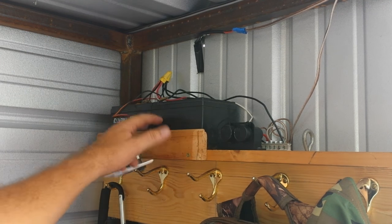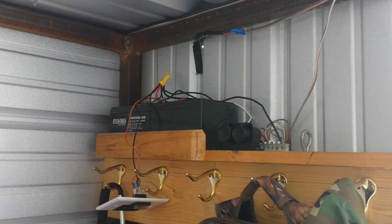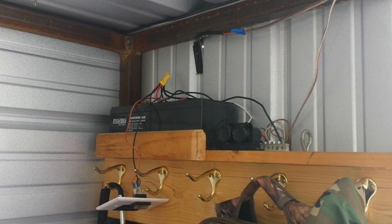So I got them hooked back up. Don't have them charged yet. We're gonna eventually run one of those little 1.5 or 2 amp solar chargers out the back just to keep them topped off while it's sitting here parked. Anyway, that's 12 amp hours. I got them in parallel, so 24. It runs these lights in here and the porch light thing all weekend.